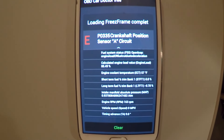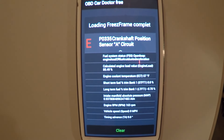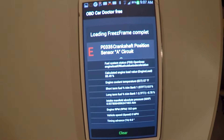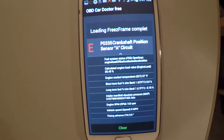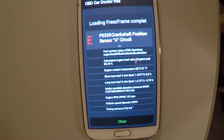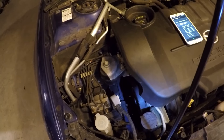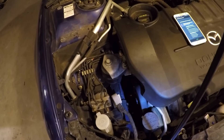It's pretty common for the crankshaft position sensor to go bad over time. The error code is aligning with my car startup problem, because when I start the car the sensor is not able to quickly detect the crankshaft position. Therefore it doesn't send the signal to fire up the piston. According to the OBD scanner, it's obvious we need to replace the crankshaft position sensor.